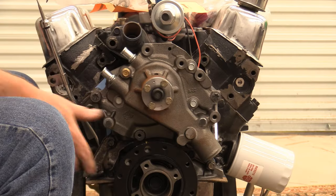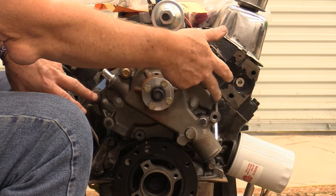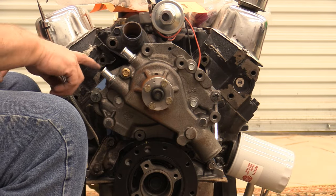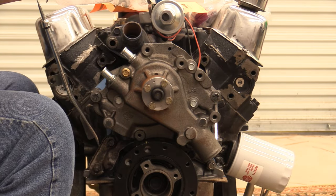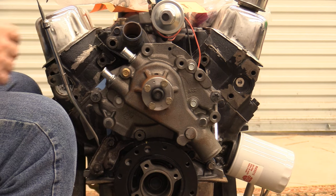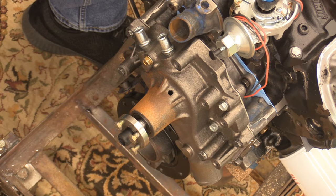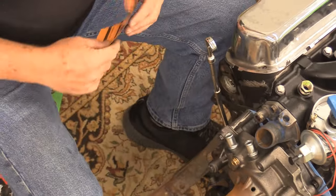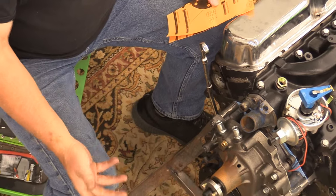There's your water pump installed. Basic tech tips: put two bolts in first — there's usually two like these two here — put those in first because you can run them into the housing and it will hold it in place while you try to get all your other bolts sorted out. My tech tip is get a new bolt kit from NPD and use the AMK kit because it's a really nice, original-looking kit.